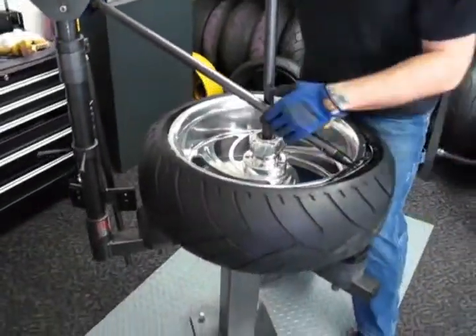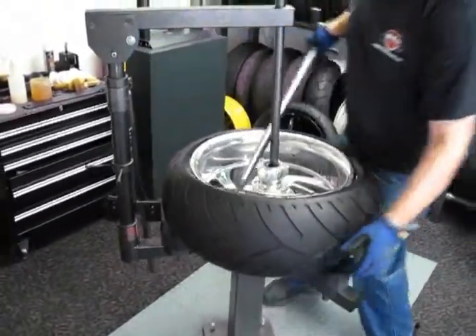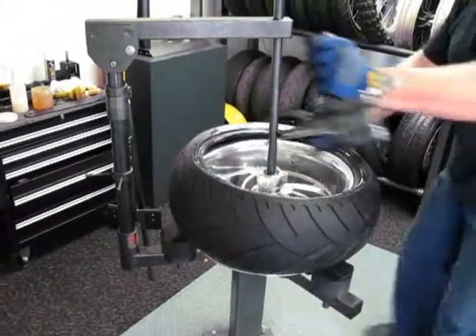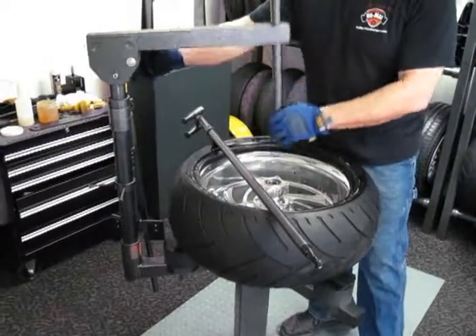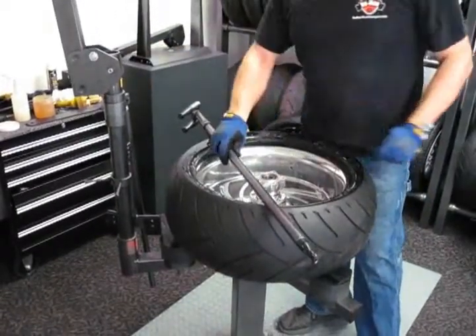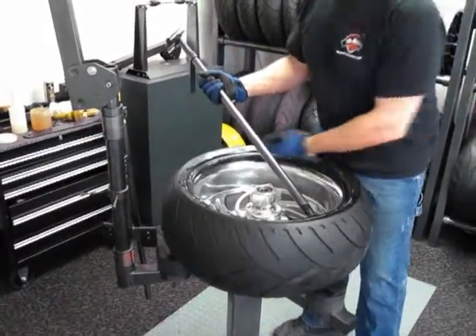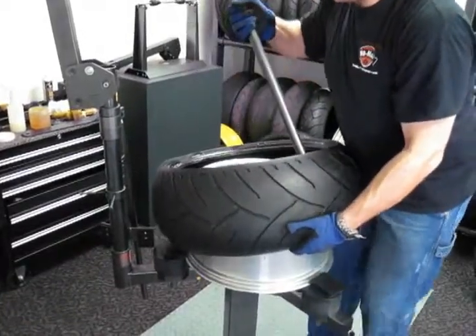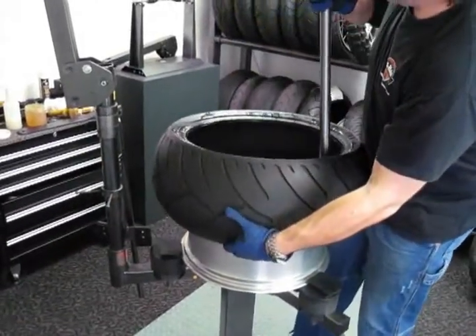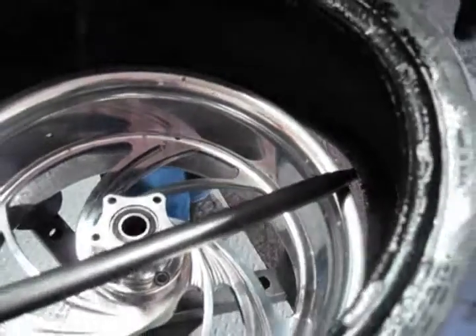Hold the tire and keep your bar — if you have a rotor on here, keep your bar up over the rotor. Remove the first half. Generally you don't need to remove any rotors when you're using the mount/demount bar. Always keep the non-marring tip on the top edge of the rim. This is a really wide tire, so it's important that the backside be dragged up for clearance. Get the backside up, bend the top of the tire, hook the lobe on the bottom, and set it down just like you do with every other tire change.